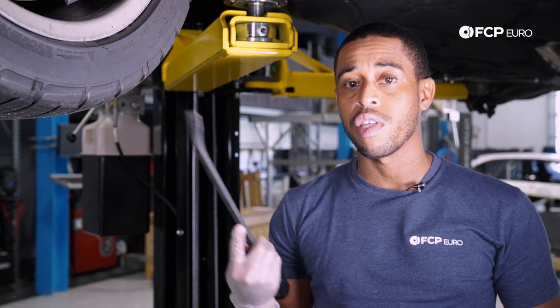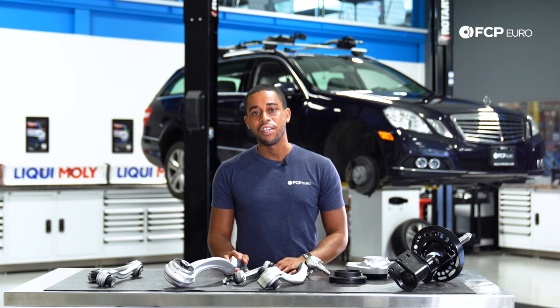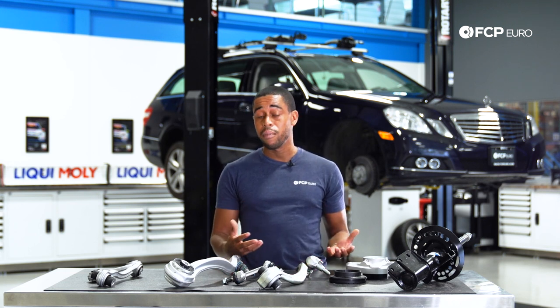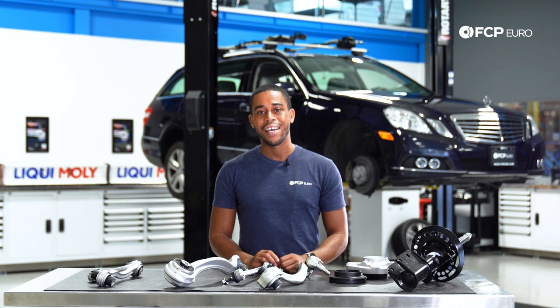Another thing to be aware of when diagnosing air suspension issues: if you notice the vehicle is not sitting at the correct height or is sitting too high, when you're inspecting the upper camber arms there is a height level sensor attached to it. Sometimes that linkage can break — if you hit a pothole, it may pop out of the socket and the air suspension system won't know the correct height of the rear axle. So this is definitely something you want to check. We've now checked out the front and rear suspension on the W212. A quick tip: if you are changing your oil or transmission fluid and you're under the vehicle, that is the perfect time to check your suspension components. At around 70,000 miles, everything in your front suspension is probably going to need to be replaced; at around 110 to 120, take a look at the rear suspension. If you have any questions, be sure to leave them in the comments. Like and subscribe — thanks for watching.